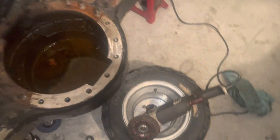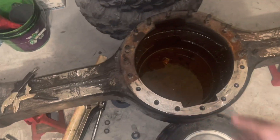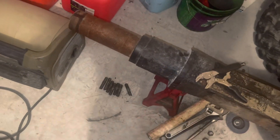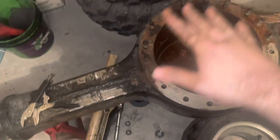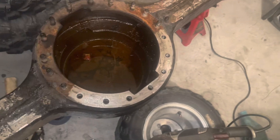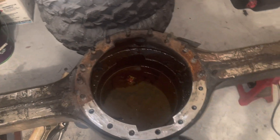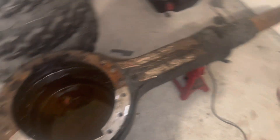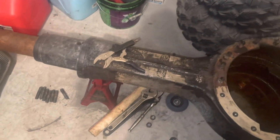We started a little bit but we're out of blades and wheels. We're popping studs out, then we're gonna run a tap through them, clean all the threads, wire wheel and make the studs all clean, then replace all the hardware with grade 8 lock washers and nuts. We're gonna keep using the studs, clean the insides out, and get this whole axle down to bare metal. But this is night one.